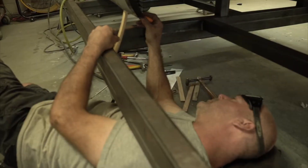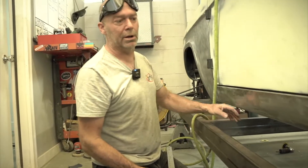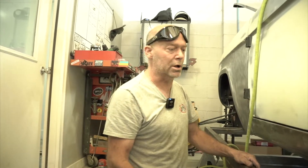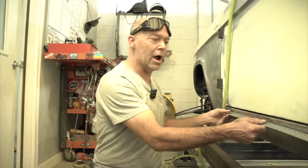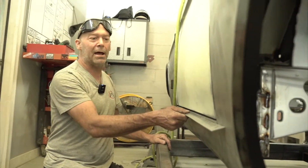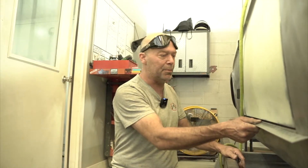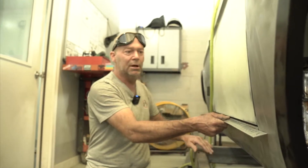Today we're doing some surgery on this Bronco — working on the rockers, rocker to the quarter panel. When this one came in, the body was built at a different shop, and when we put the doors on there was no room for the gaskets. So we had to move the rockers out and the quarters out so there's room for the gasket and the door can close. Now we're in the process of moving the lower part of the rocker panel out to get a good straight line going front to back. We don't want to load it up with bondo — some shops put a couple inches deep of bondo and that's just not the right way.